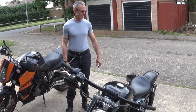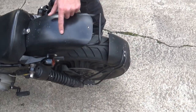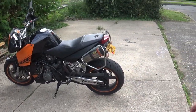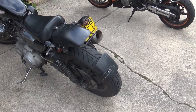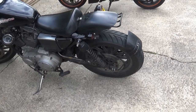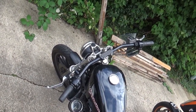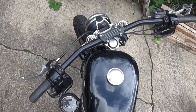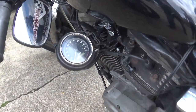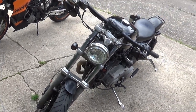Other than that it's just had things like the mudguard chopped and a rear hugger put on to try to reduce some of the spray that comes back. Even so, you can see I rode it in the rain yesterday and you just get jet-washed even with this on the back. The only other real change at the moment is I've just chopped the front end a little bit — got rid of the eyebrow and dumped the clock. The tacho stopped working so it's come off and the speedo is down at the side, out of sight, so when you're riding all you see are the handlebars and the headlight. No instruments or lights in your way — just the pure riding experience.